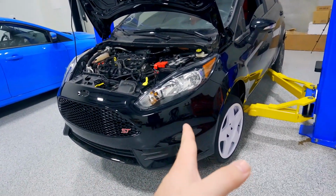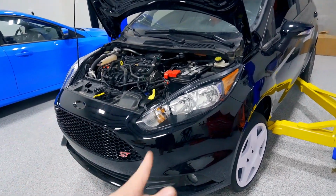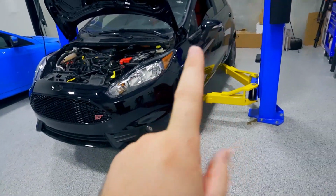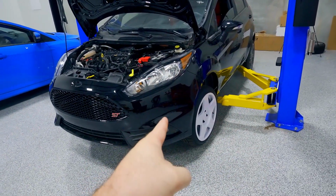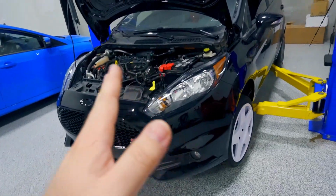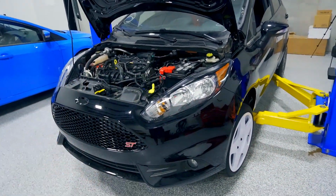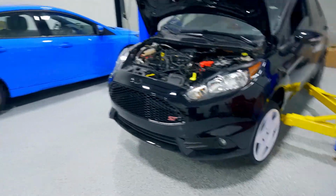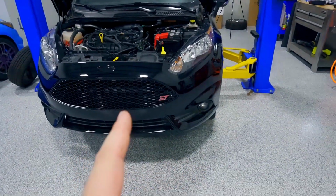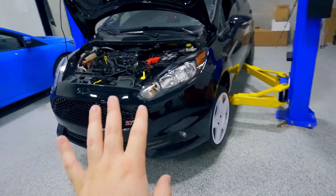It was a pretty good hit on this corner, and we know that the subframe has already shifted over to the passenger side. So I'm just going to swap this one out, and while it's all apart, I'm going to change the axle seal on this side of the trans and refill the trans, and then I'm going to pull the downpipe. Actually, I'm going to pull the whole stock turbo stuff out today, and then the next video will be putting this turbo on. And hopefully at the same time, we'll be able to do the install and then immediately hit the dyno.